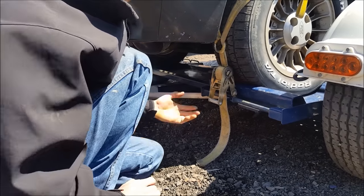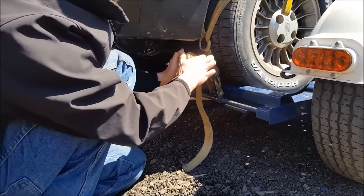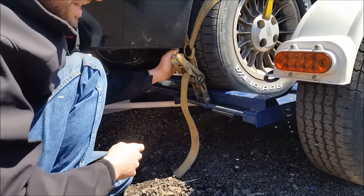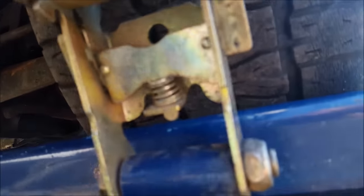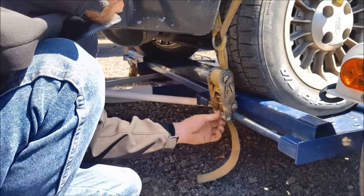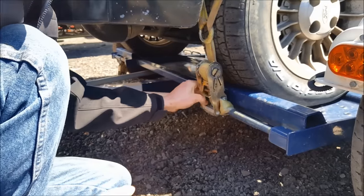One thing to note: sometimes you might have a car that has a really low bumper and you actually can't get it into the full position to release. To take care of that, you're going to go in here with a screwdriver and stick the screwdriver in this hole back here and push down — this is your release mechanism, this is what will release it. So you have to push this plate down. Once you get this thing tightened down, pull this down, put it in its lock position. Make sure to take your excess and tie that off somewhere so it doesn't dangle in the wind.